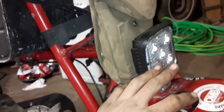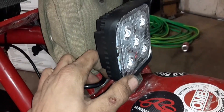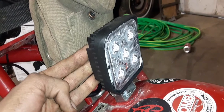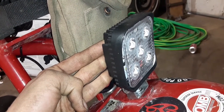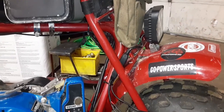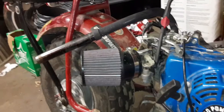This is the headlight I got for it. I didn't want to weld to the frame of the bike, so I took the front rack off and used the existing fender bolt to mount the light. It's a tractor supply light with a solid aluminum casing. Two of the light bulbs are already burning out — it's brand new. It's 15 watts, about two or three amps, so it doesn't draw too much power. The goal was to wire it to a toggle switch, but I'm currently having wiring issues on the Tillotson so it's on hold.